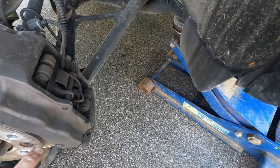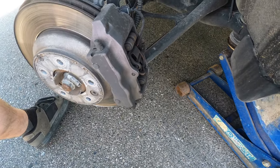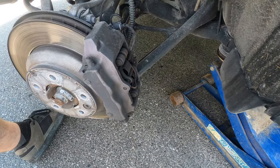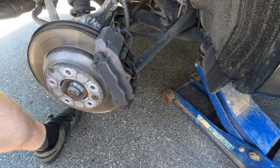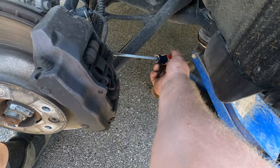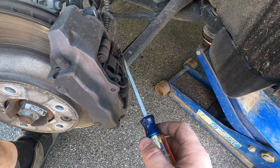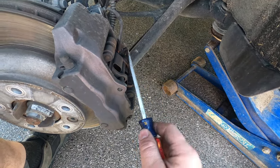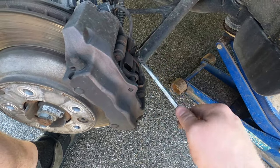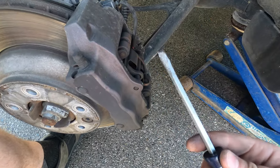This is pretty cool — this thing's got four-piston rear calipers, it's pretty wild. You've never had something like this. It's odd getting nice stuff. The rear ones show that the front one had the bolt screwed into the back here to hold it in place, and this just exaggerates how unimportant that bolt really is. Because the rear ones just have a little pin here that slides through and holds it in place — they pound it in and put on a pin to make sure it doesn't wiggle left and right.